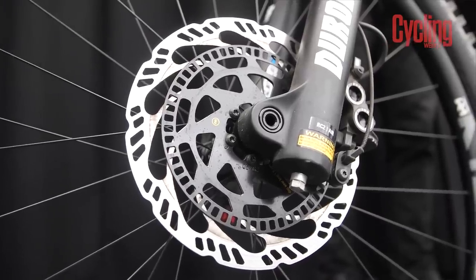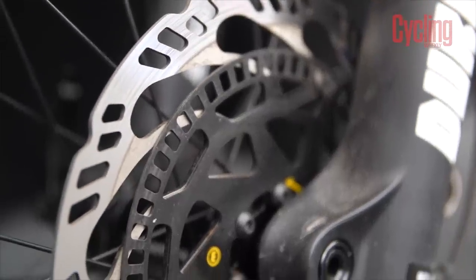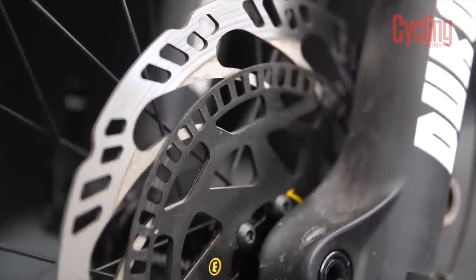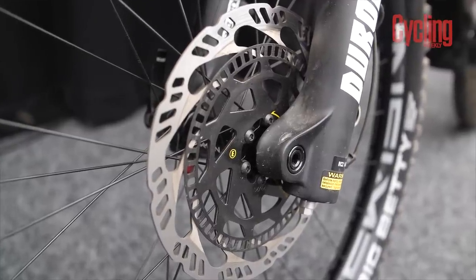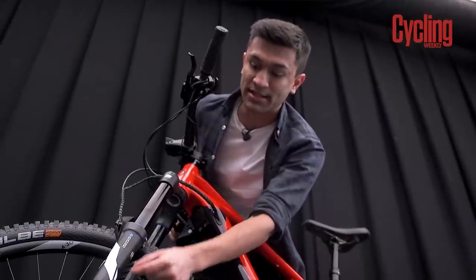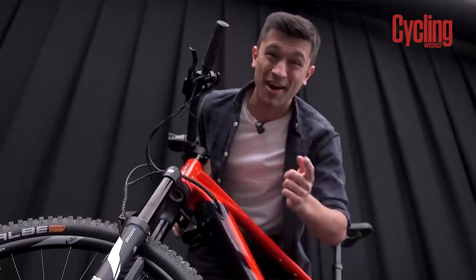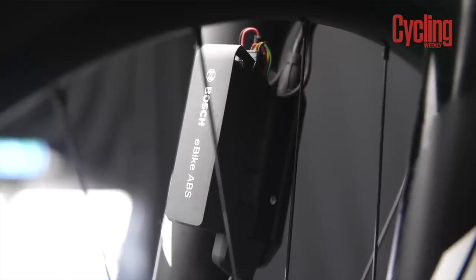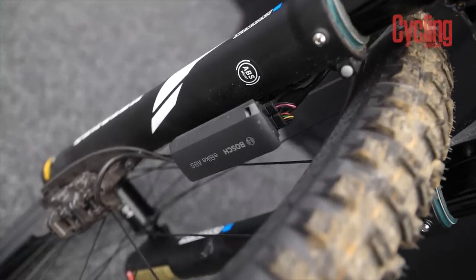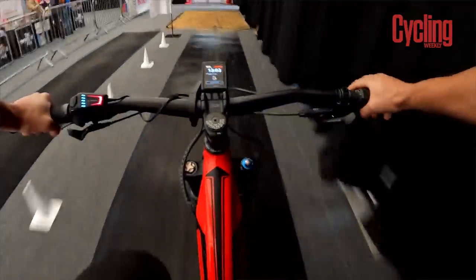There is a little reservoir in there which controls how much power is being applied to that front brake. The brake rotors look a little bit funky because they've got a black inner ring where a sensor in the brake caliper monitors the speed of that front rotor — and you've got exactly the same thing on the rear. The brain monitors the speeds of both wheels individually and applies the braking force to the front brake only, managing how much power is exerted and making sure you're not locking up and skidding out. On the gravel you can really see how the caliper will bite, release, bite, release — just like it does on your car — to make sure you stay in control.